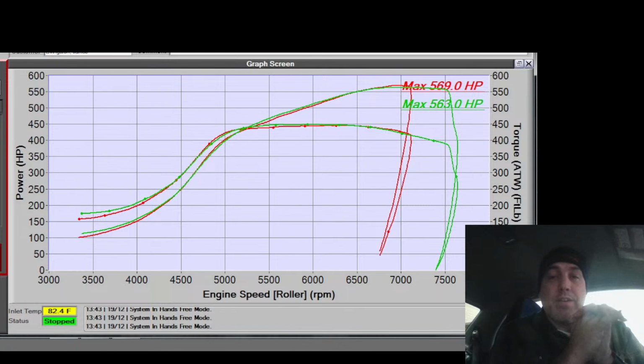And right here, I can almost guarantee you we are kissing that limit right now. We are right freaking there. So it's important that you are familiar with one of these turbos if you're going to tune one without a speed sensor, to know when you're really about at the limit. Right here, I can see by the power output that we're close to the limit. About another 25 horse to the wheels-ish in that range is usually going to be over the limit. It will probably be about 5 or 10% over the limit if I add another 20 horsepower here or so.